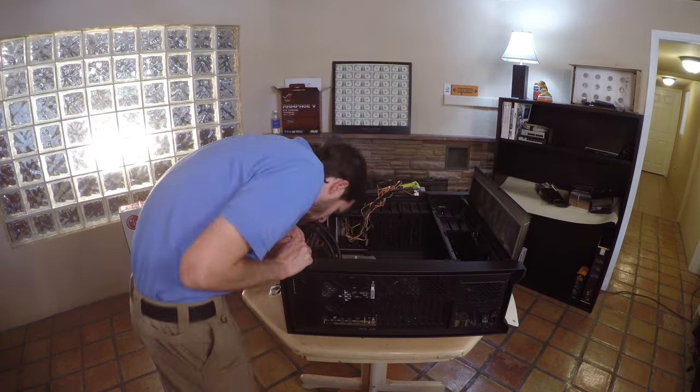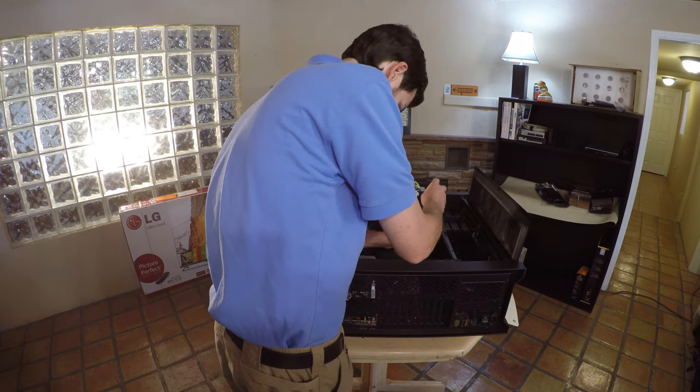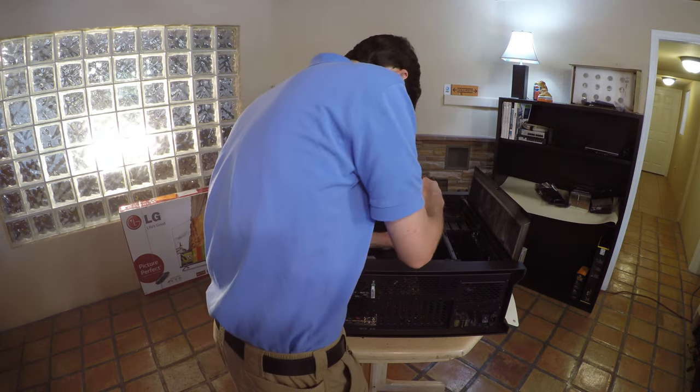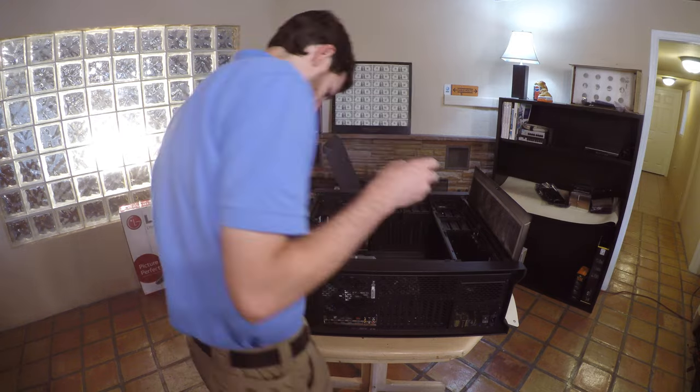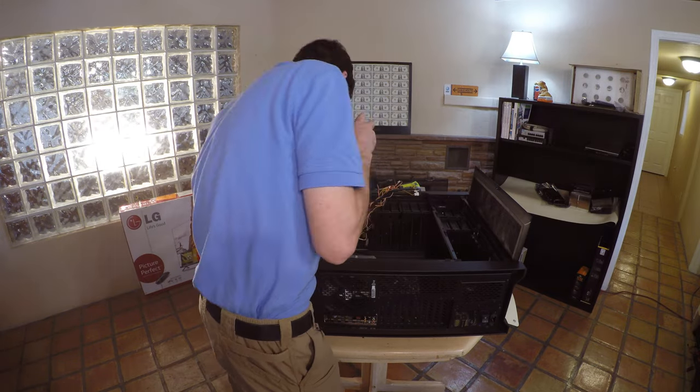All the stands need to be measured exactly to fit the motherboard. Carefully fit the motherboard in place and then secure the screws, but do not tighten them at first. Verify that the backplane is lined up and everything is in place, then you may begin to tighten each screw.